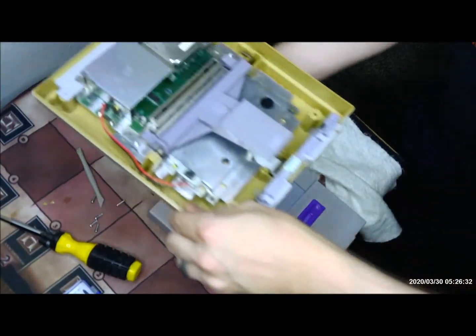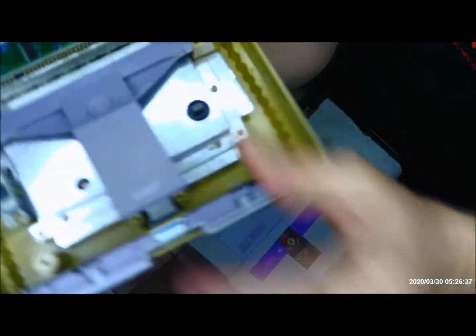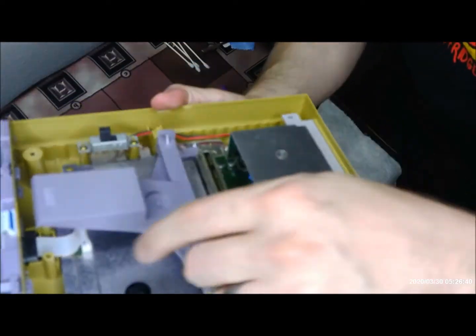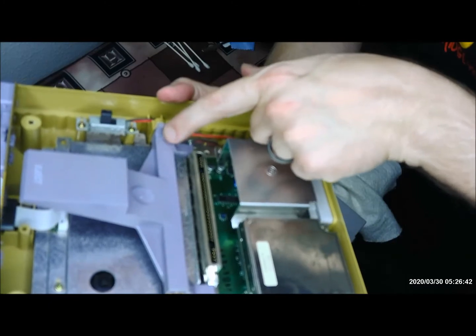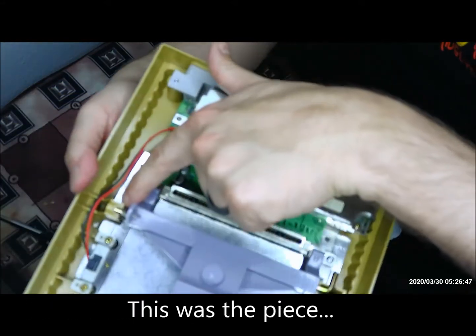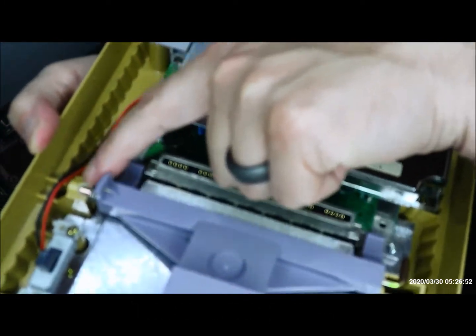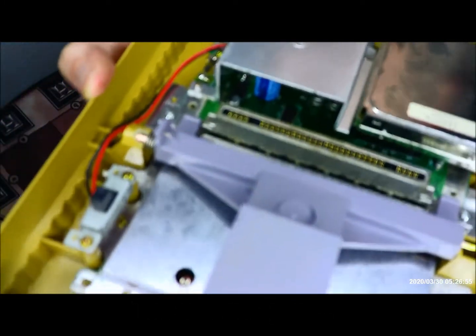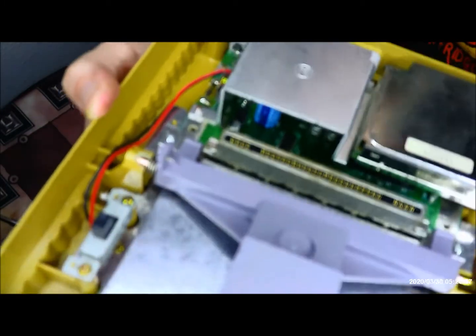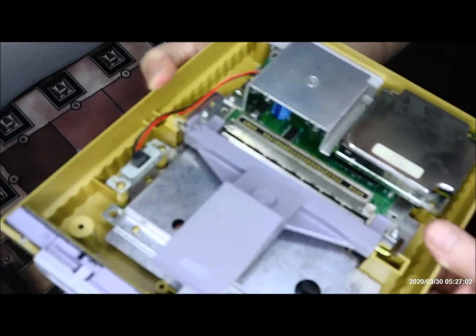Alright, I'm sorry I had to do that off camera, but there's a little groove here, see if you can see it, where the small end of the spring pin goes. The large pin goes into a little compartment underneath this section here. Unfortunately, I broke part of this off when I tried to put it in, so thanks, other Super Nintendo guy, who led me down the garden path. I'm very annoyed at that, but we're doing the best we can.